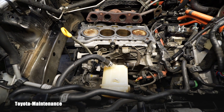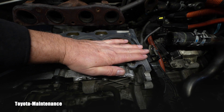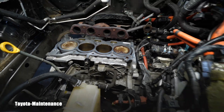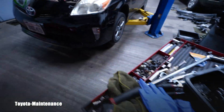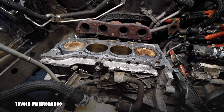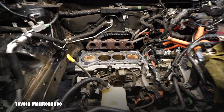Here is the engine block — it's in the car and cannot be removed. This area also needs to be perfectly clean and flat so I can put the new head gasket on it, along with the resurfaced head, and then torque those head bolts correctly and squish that head gasket so well that it won't leak, hopefully for another 150,000 miles.